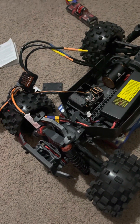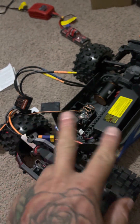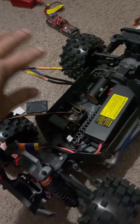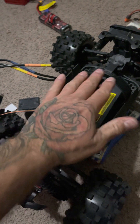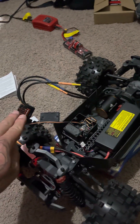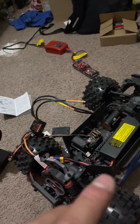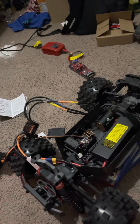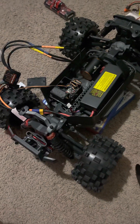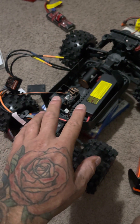I came across a video where the motors on brushless systems and the ESCs are backwards. This is only for sensorless brushless motors. If it's sensored, what's going to happen is you're going to fry your ESC, and you don't want that. ESCs on brushless systems can be pricey depending on the brand, the amperage, and all that. But this is a sensorless motor.